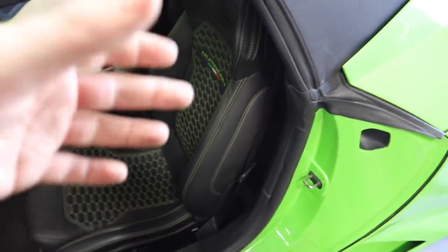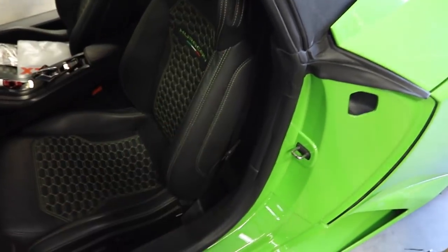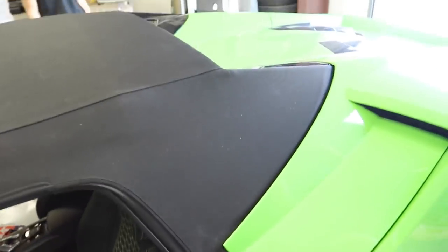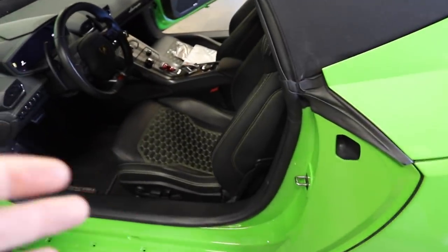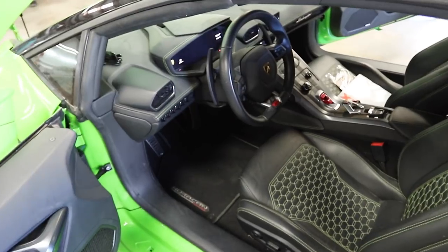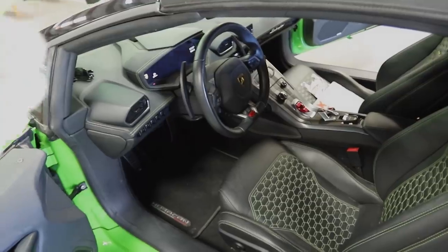To get the airbag system cleared, you obviously have to replace all the busted airbags, the different charges, igniters, and everything. We really didn't have any bags blown except for the one on the seat, but we had the seatbelt auto-tensioners and the pop-ups that had deployed — all of which have been replaced and wired back in. Now it's essentially just plugging in a computer and telling it to recheck itself and verify everything's correct.